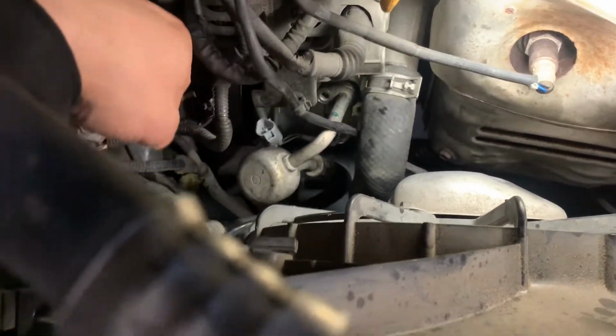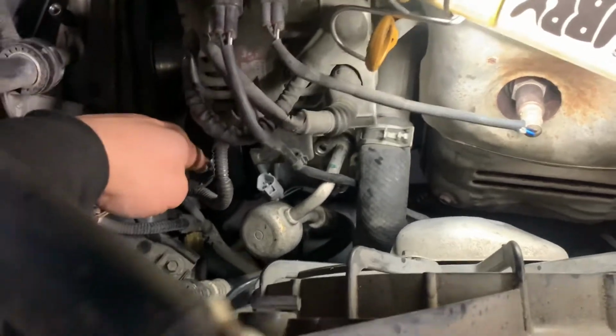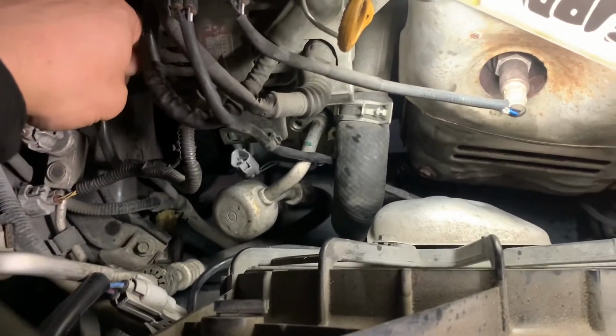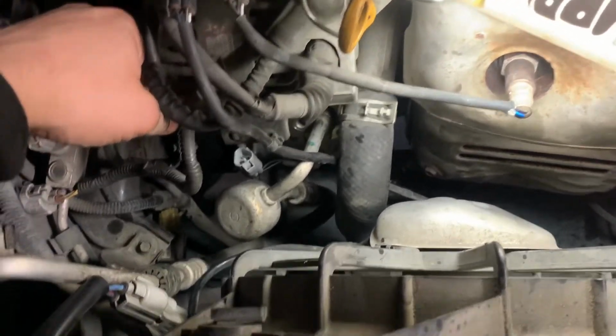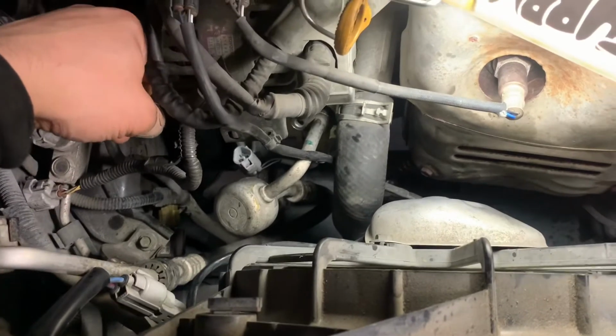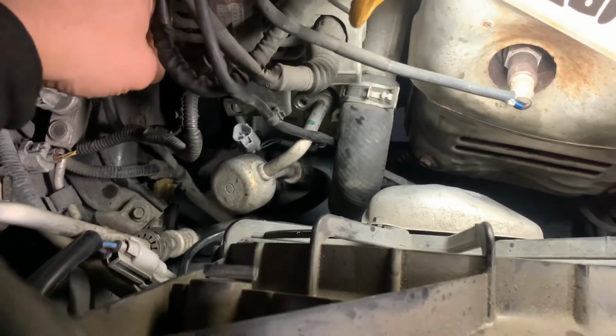And since I flushed the system out, we're gonna have to put some more oil in the system. We have already put 4 in the AC compressor, and when we fill her up with Freon, we're gonna add an additional 3.5 total, 1.7 for the evap and 1.7 for the dryer. So we're gonna go ahead and finish that up and we'll be done.